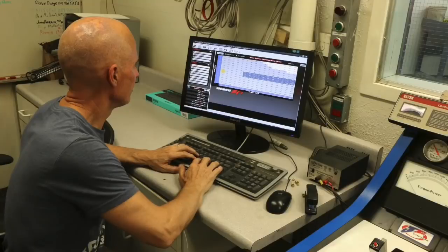So what the heck's going on? Well, I have tales of woe for you. I went to run this thing last night and spent hours and hours on it and I could not get it to work. I thought maybe I forgot everything I knew about tuning and maybe I'm not so special after all. After spending a ton of time trying to get the air-fuel right and the timing right, this thing would load okay and release at about 3,500 RPM, and then when I got to 4,000 RPM the power would just take a nosedive. It was terrible.